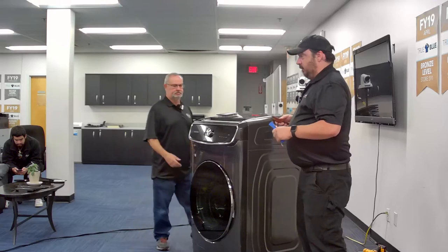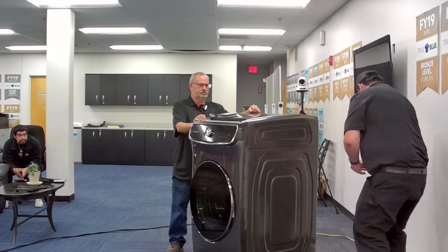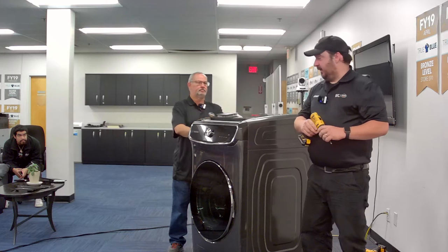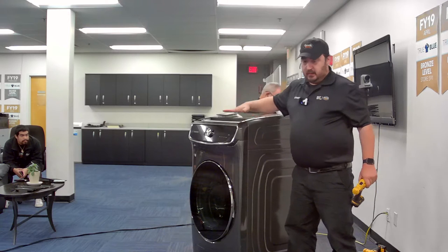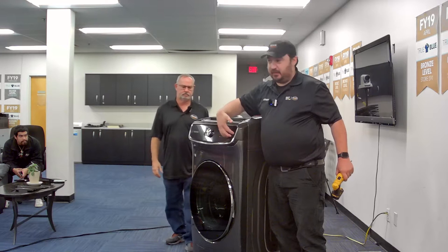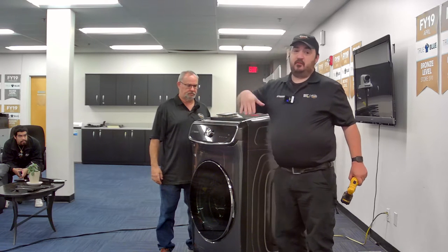That's probably one of the hardest parts of this whole thing — getting that part off. It's the most fussy piece and the one you have the most chance of breaking while taking it apart. Start with the center one first, then do the outer sides. If you are doing one of the older versions, notice the UI is completely different — more embossing on the front, a very different panel — but it comes apart and goes together the exact same way.